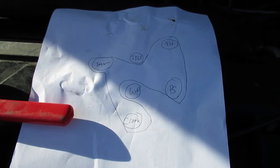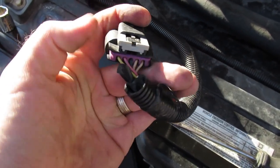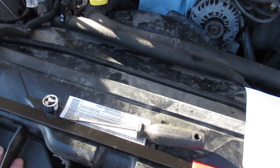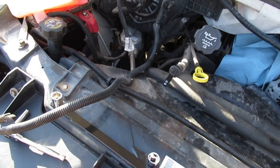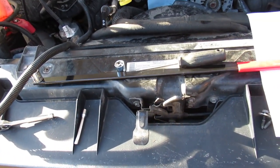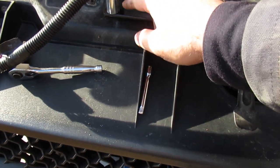Alright, so we did our map of the belt and the pulleys — got that figured out. There was a plastic clip that turned up during the work; it was related to the electrical connector on the air intake system, so I slipped it back in. Whoever had this part last time must have lost track of it. Also, this van had the radiator replaced some time ago. It's had a slow leak issue — I was told that the hose where it mounts on the radiator could be a problem, so I'll take a peek at that later. You're going to use a 15mm socket, but the one in this kit isn't deep enough.